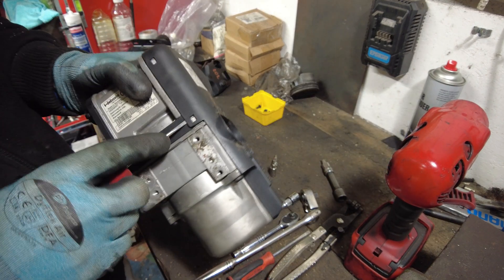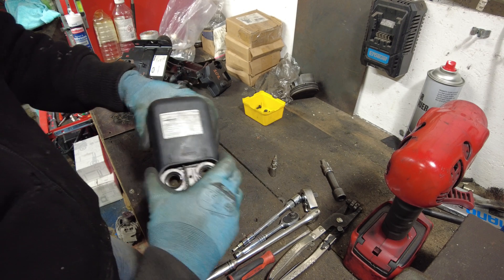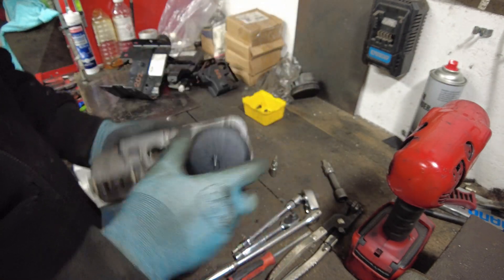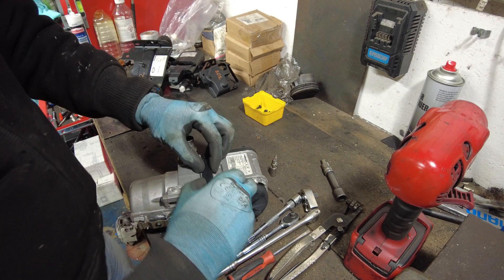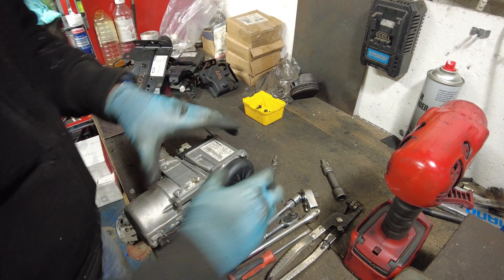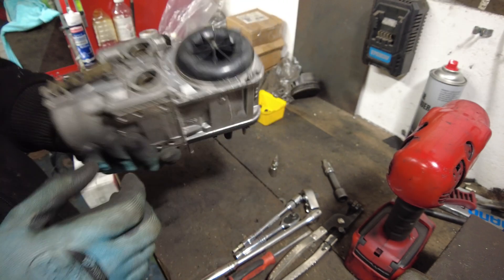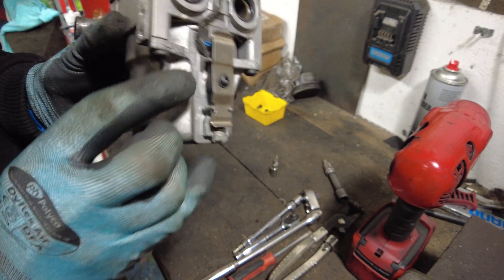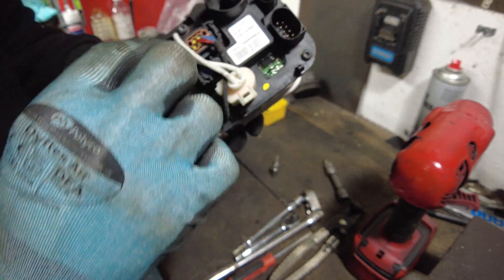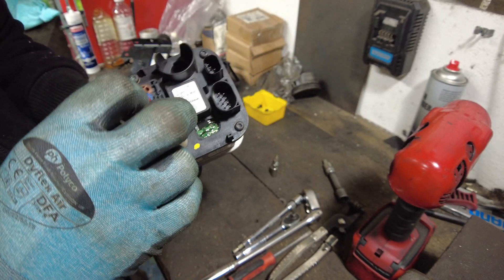Same with this cover — this one's a little bit more awkward. On this side, this covers up the fan. This pops off — just a cover that covers the fan. Down here are the coolant temperature sensors. That wiring runs into the ECU. This plug here goes off to your glow plug. There's another plug here that isn't used on this model, but that's for fuel preheating, and some of them have a solenoid valve.